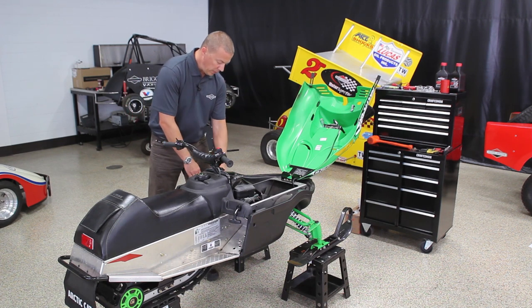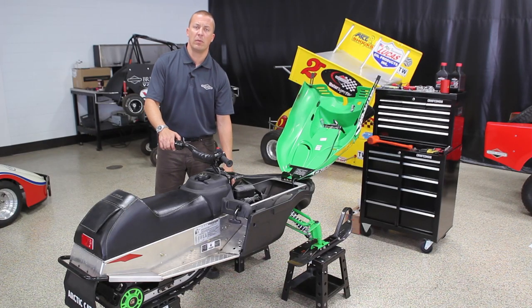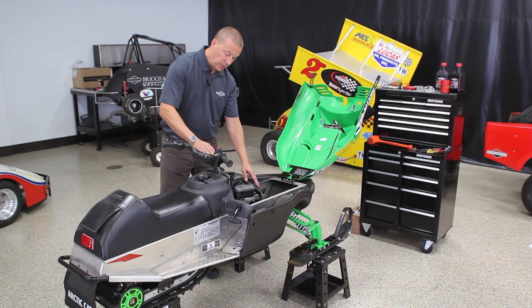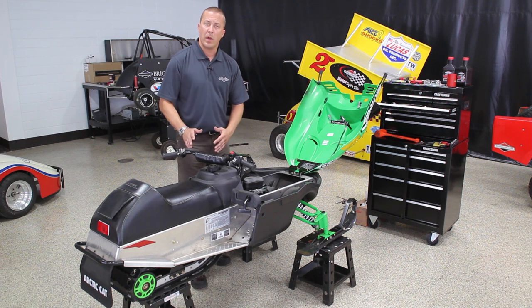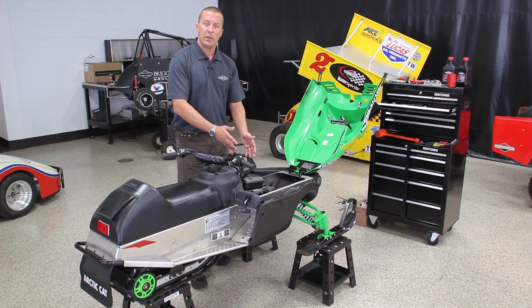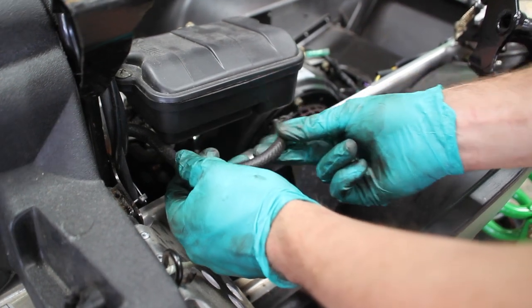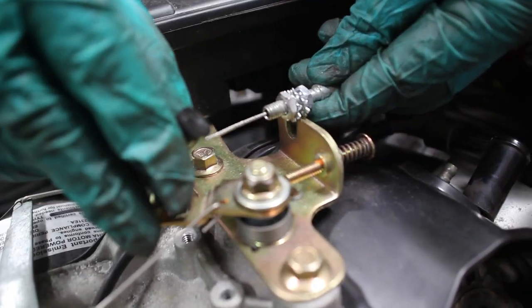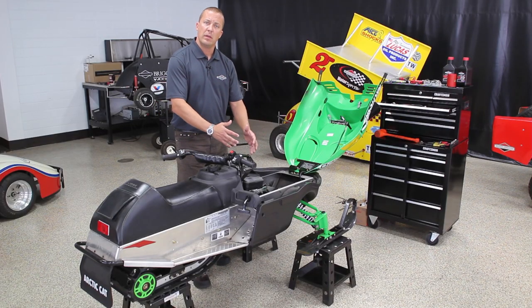Now we will remove the three half-inch fasteners holding the engine to the firewall. We'll get underneath the sled and remove the four rubber biscuits to access the engine mount. We're also going to remove the steering column to allow us access to remove the engine. Now that the steering column is out of the way, we have access to the underneath of the engine. We'll remove the fuel intake — remember, we've evacuated all the fuel — and plug it for safety. We'll remove the throttle linkage and choke cable, undo the rewind to pull it through the firewall, then loosen the four fasteners holding the engine and remove it.